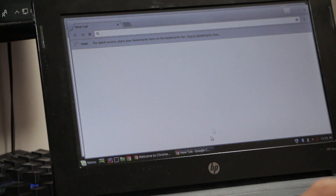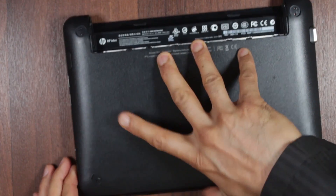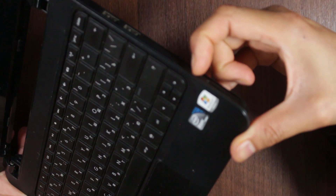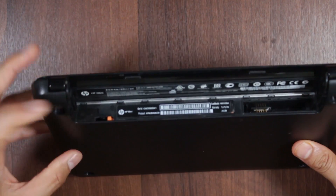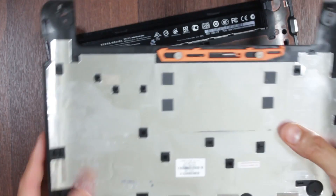What we're going to do today is show you inside the laptop. I'm not going to bother switching this off — we'll just unplug it because the battery is dead. This is one of the easiest laptops to take apart. I'm going to use a top-down view since we're recording. Take the battery off, then press and hold the power button for at least 30 seconds to discharge any potential static electricity. After you remove the battery, you can see there's an orange tab — pull that to the left and the cover comes off. This is one of the easiest laptop covers I've ever taken off.